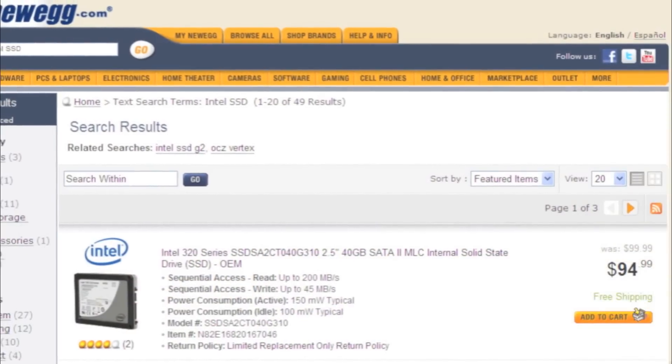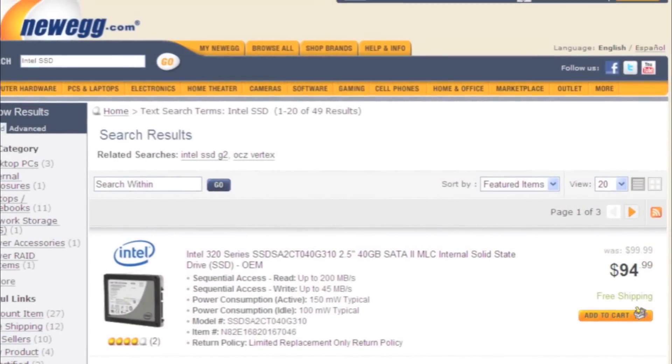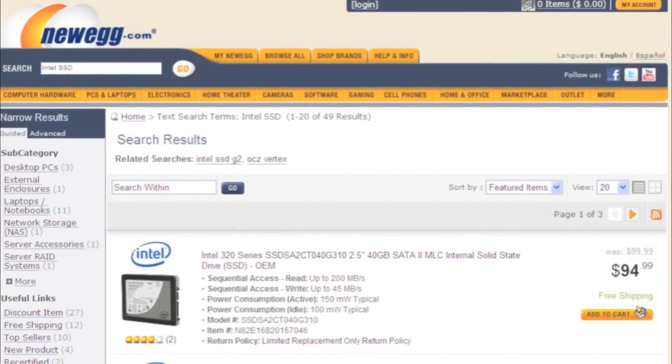Many of you out there probably have a low capacity SSD because obviously they're much cheaper. Maybe you've got a 40 gigabyte or a 20 gigabyte SSD, and the price difference between 40 and 80 gigabyte is quite a bit — and 80 gigabyte and higher is beyond the price limit of most consumers. So Intel Smart Response Technology allows customers to get the advantage of higher capacity SSDs by just using a normal hard drive and a small capacity SSD.